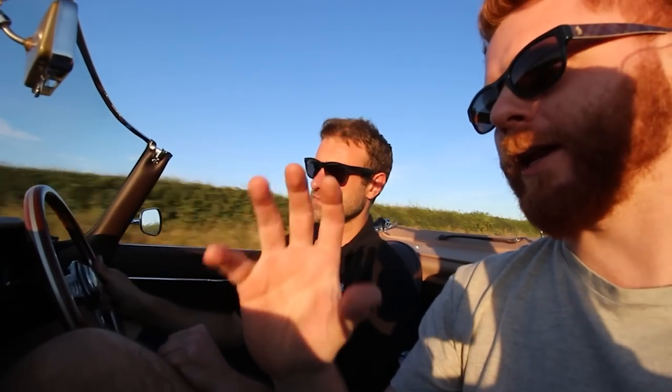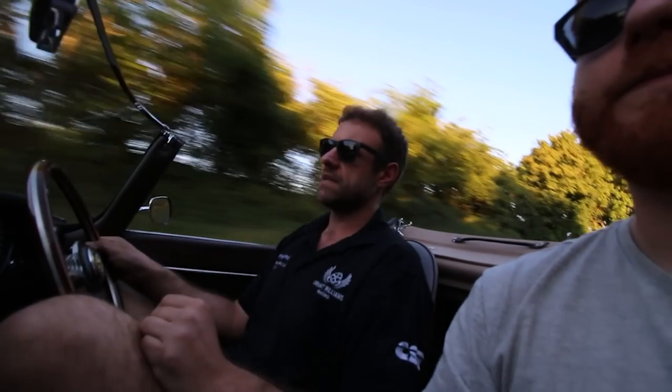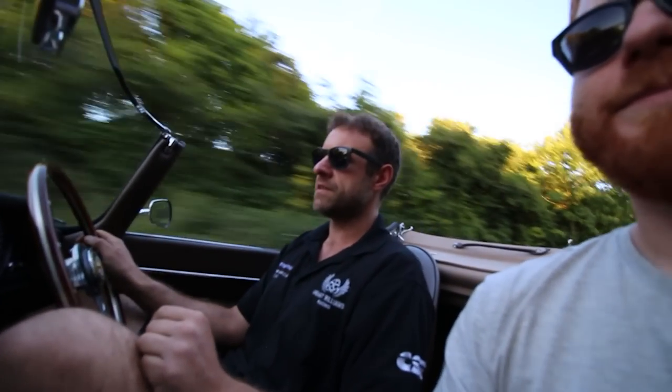So with just using the Dizzy, that's just an electronic Dizzy, so you can't program any timing through it. You program the timing through the ECU, so we're literally using the Dizzy as just a spark issuer. We're telling the coil the dwell time, saying, right, you need to fire now, and do it that way, so it is still fully programmable. Oh, wicked. Excellent. It just wouldn't have looked right if we started using a coil pack. And then having modern leads on it and stuff. Yeah, that's it. So it just looks a lot more period.